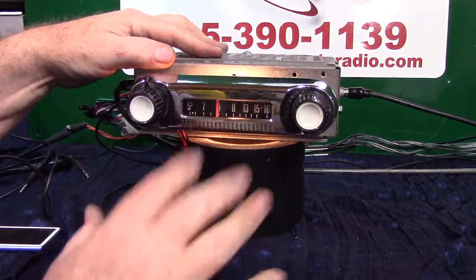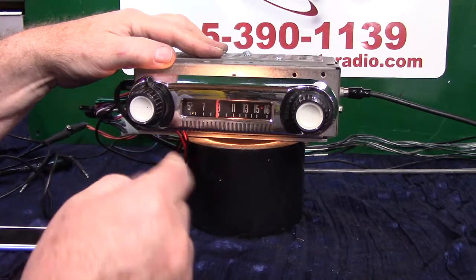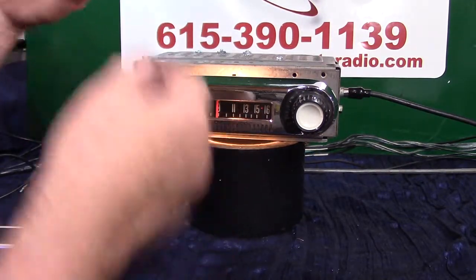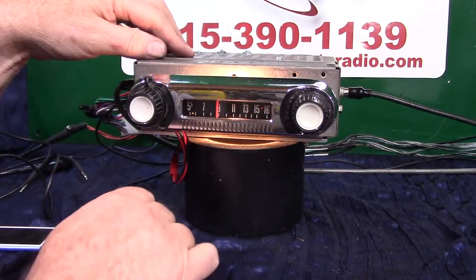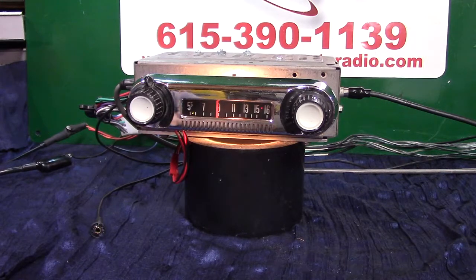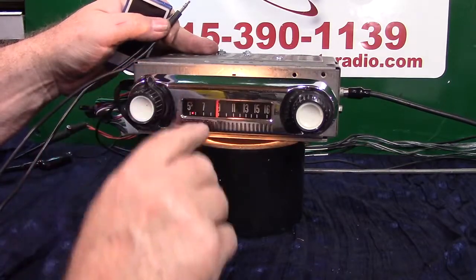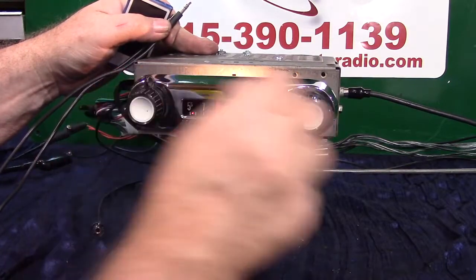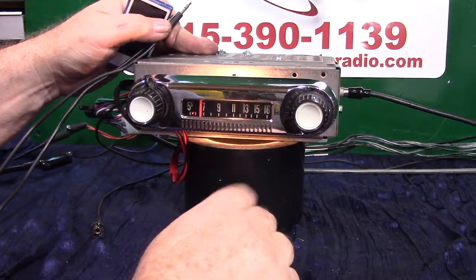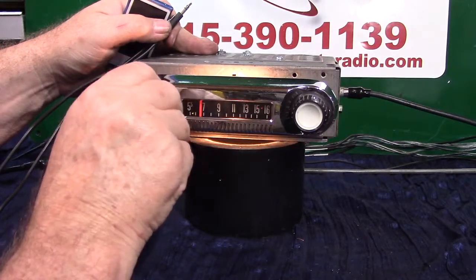Your fader and balance depend on how many speakers you've hooked up. Your LED lights — when you put the plate up there, you'll see a place to put a little hole so you can run those two leads through, and then underneath the truck after you get it in, just plug them in; they'll be marked for you. Auxiliary in is automatic. If you want to go to AM radio, just turn it off and right back on — the little light goes to red and it takes you to AM radio. Here at Nashville it's 650. Off and right back on takes you right back to stereo FM.